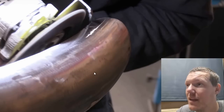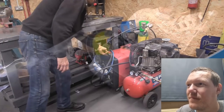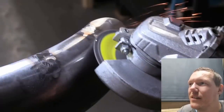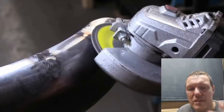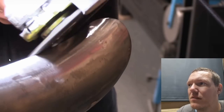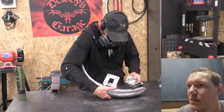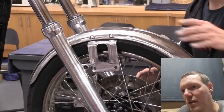If you have a curved surface you grind with the curve - constant motion. You do not go like this and this and this, because all you're doing is creating loads of facets. This is why when you're this close you don't use a grinder - you get a DA sander out, the orbital will go over it. Go with the curve.